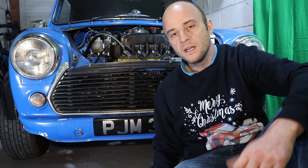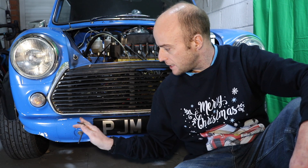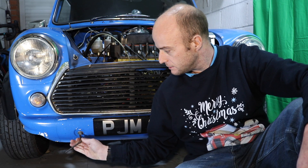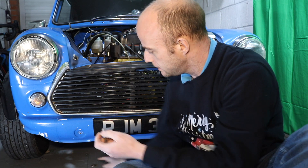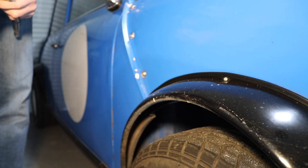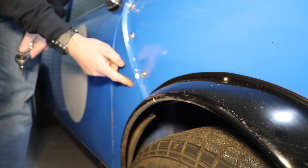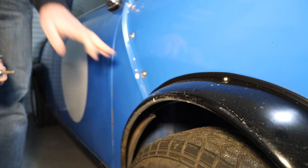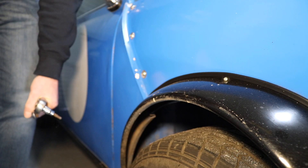Mission accomplished. I've been asked quite a lot, mostly on Instagram DMs, how I've mounted the front end, so I'll show you a little bit of that in this video. The front edge is bolted with these M8 cap head screws that go into a bracket I've made that mounts on the front of the subframe. These are quite simple, they just unscrew. On the other side of the car I've basically got these three Allen key flanged bolts that go through a plate that's welded to the inside of the inner wing.